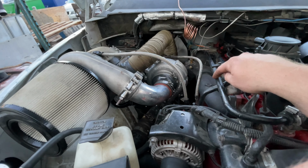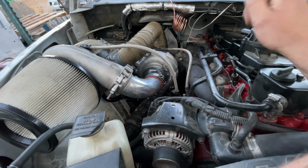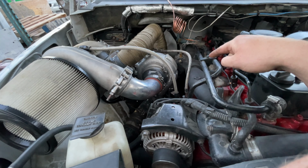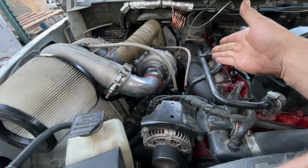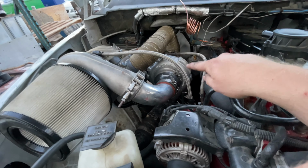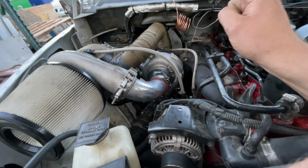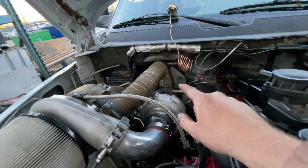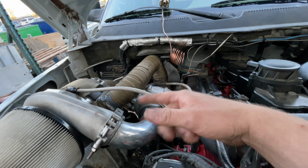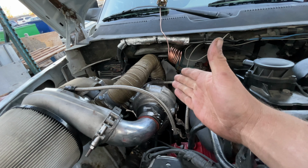The BD exhaust manifold, I won't give you a price on that. If you want one of those, you can buy one of those. I would prefer a Steed myself, but at the given time, I had this manifold and didn't have a Steed. Now I have a bunch, so I would have used it on there, but anyways, it is what it is. The turbo drain on the K27 is the original one to the truck, so obviously off of the truck. The flange that's on the back of the K27, I actually machined myself, but you can buy them from multiple different guys. They're about $45.